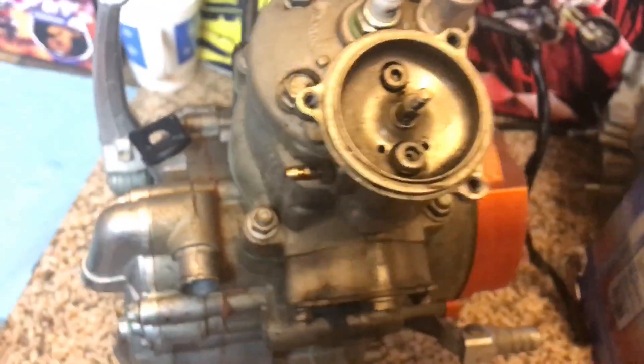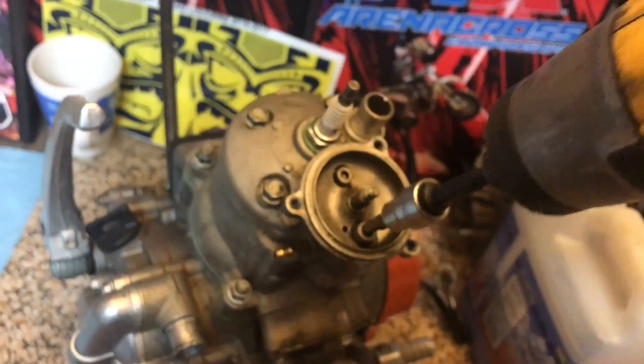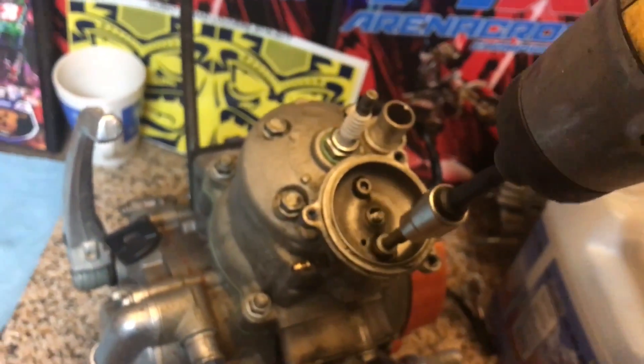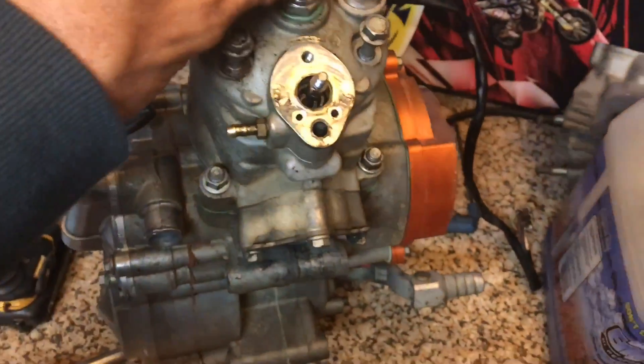Here's another thing — these are two different sized screws, which I don't know the reason for. Most people hate me for using an impact but I only use it on the breakdown and then torque everything on the way back in. That leaves your power valve spring, which is the stock spring. Then you break your four ten millimeter bolts and the head comes off.